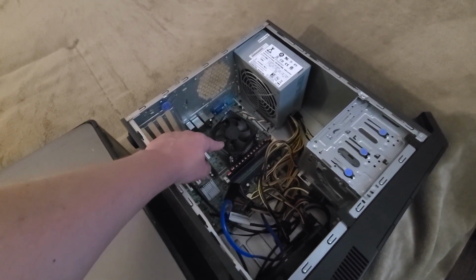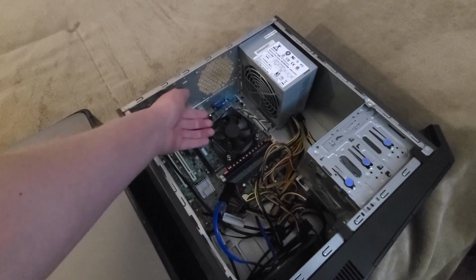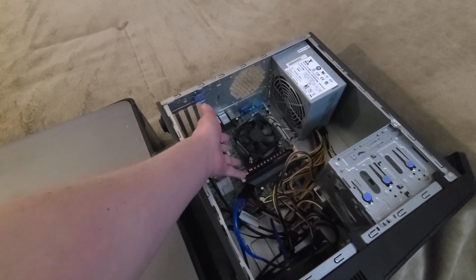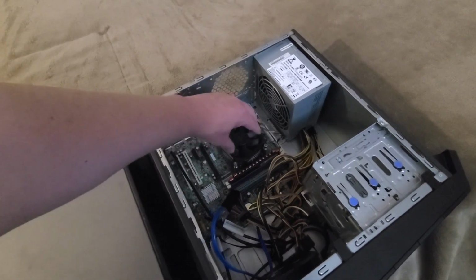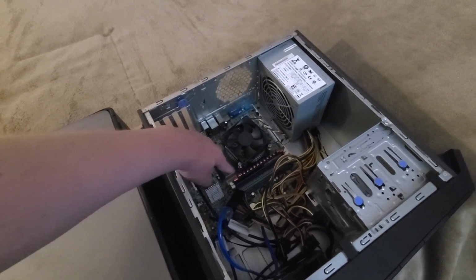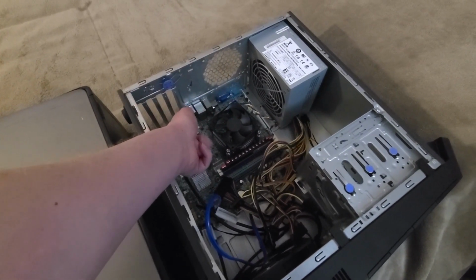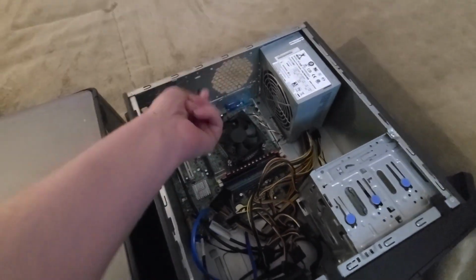It's supposed to work. So what HP likes to do is the back plate behind the motherboard, that hooks this cooler in, is metal. And I always assumed it was Intel, but I never checked it. But that back plate has the screw holes that hook in, because on these, the piece that holds and locks the CPU in is screwed into the back plate. So that is all one piece. If you go to replace this cooler, you really couldn't easily do it, because the back plate is actually screwed into the arm piece that opens, and you put your CPU in and then relatch it.